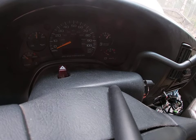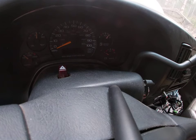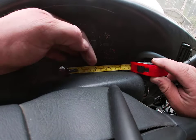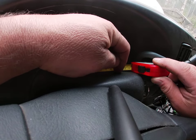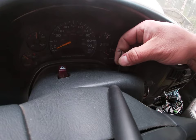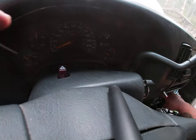I'm working on this 2000 Chevy Express van to replace the lock cylinder. A little trick I learned: use a tape measure to measure from the hazard button straight across three and five-eighths inches, mark that spot with a sharpie, and then drill a hole into the shroud. I just use a small allen key to access it.